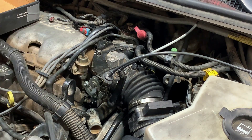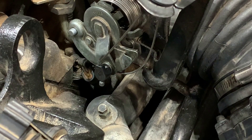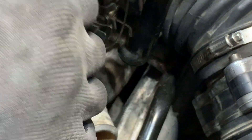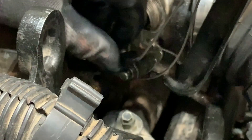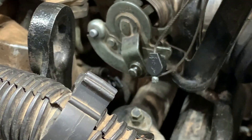Then you're gonna want to unhook the cables to the throttle body. I'll start with this little plastic one - all you gotta do is push it down. I put a little penetrating oil in there, it's good for plastic. The way this is set up, all you're gonna do is push it down - see it's open where that little stub is right there. That little penetrating oil will help it slip right out. When you put it back in, just make sure that opening is on the bottom and slide it back in and it snaps right in. Don't try to pull it sideways or you're gonna break it.